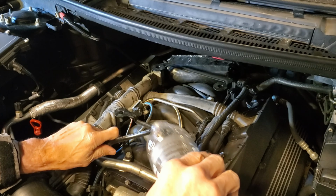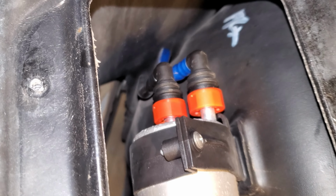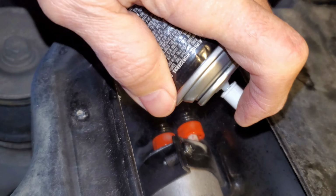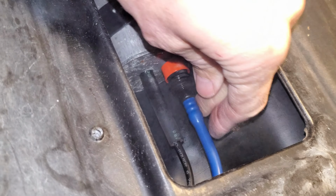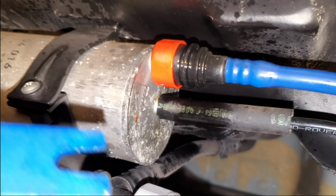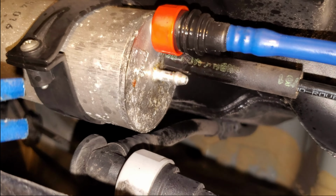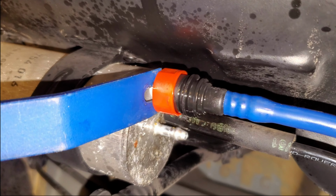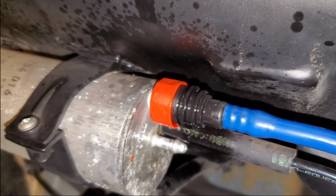And when you plug it on the fuel rail, it will keep the pressure from building. So it'll relieve the pressure. And then I like to spray those fittings with a generous amount of lubricant. Now I'm just using a Teflon lubricant. This is not penetrating oil. I don't want to damage the O-rings, but just make sure that you can move those fittings so you know that the fuel pressure is relieved. Now I'm removing the vacuum lead right now, and I'm just making sure that the fittings are loose. And once you move them around, you know the fuel pressure is relieved.